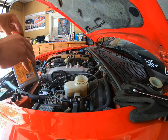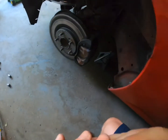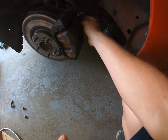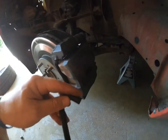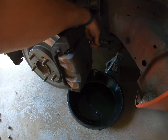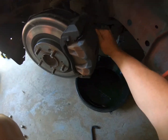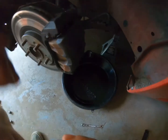All right, that's good. Like I said, first let's go to the left front tire. Down at the front left we're gonna loosen up the brake fluid drain. I do have a small little rubber piece — I'm just gonna put it on the end right here, and once it's ready this will drain it right down into my bucket. It is going to be a 10 millimeter to loosen that. I've got it loosened up a little bit — let's slip this back on and see if I can't get a little bit out.